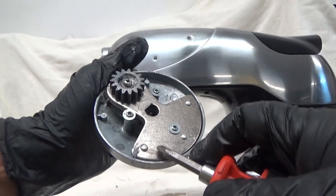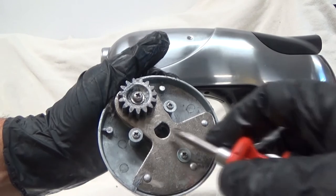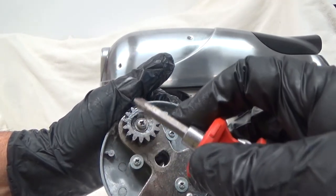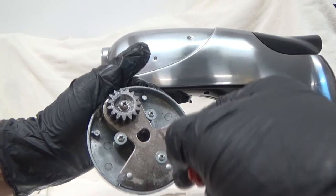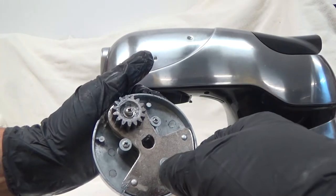To disassemble the planetary gear, I see the rivet heads are up. There are four Phillips head screws — I recommend a P2 tip. Also, I recommend a large stubby screwdriver so you can get a grip on it. The last thing you want to do is round out the head on a Phillips.